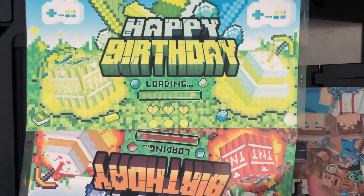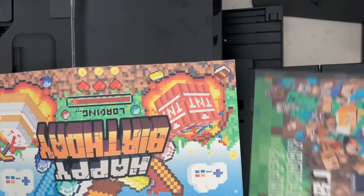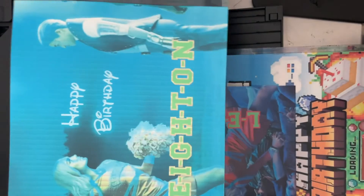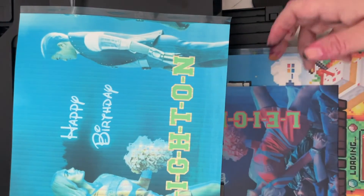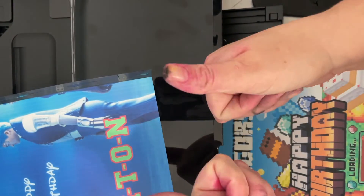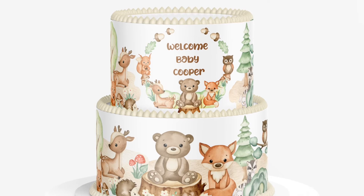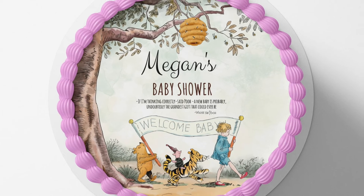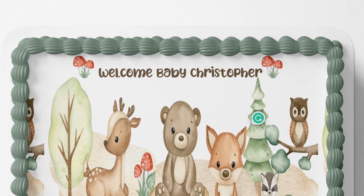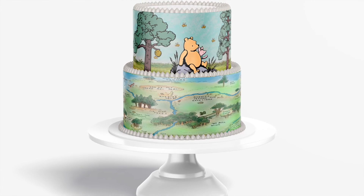Now this picture here is one I had previously printed. You can see the top picture where I realized the printhead was clogged — probably the magenta was the most clogged and you can tell by the picture. But when you reprint it, it comes out with a nice bright color. Here's another one that was missing the magenta. You can see the lines on the old print as well as the missing color. If you're getting lines or you're missing color, you need to go ahead and remove your printhead and do a good thorough cleaning of it. One of the biggest problems I see is people let it soak in water or run it through water even for an hour, but they're not using the syringe to push the clogs through the filter. You have got to use the syringe and see that water flowing freely through the other side of the printhead before you know the clog is removed.